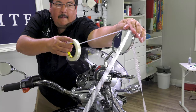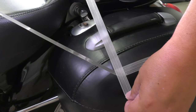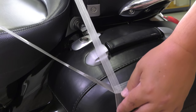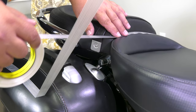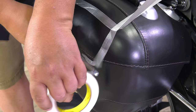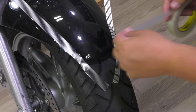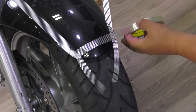To make patterning easier, we're going to run strapping tape from the right mirror to the left mirror. Then we'll apply strapping tape at the back of the driver's seat right in front of the passenger's seat, where a second panel will be seamed together. If the strapping tape doesn't have much surface area to stick to, apply another layer over the top to hold it securely. A strip of tape across the fender's front is just to hold the other two legs in place.